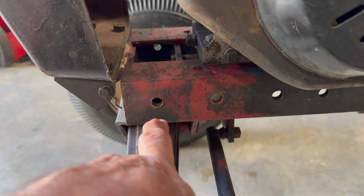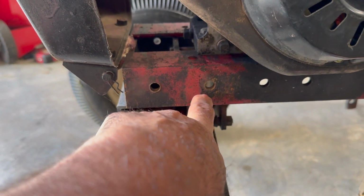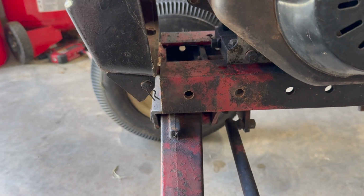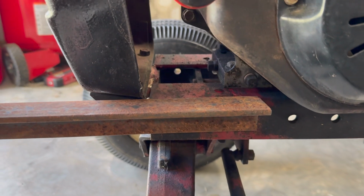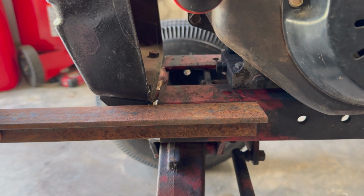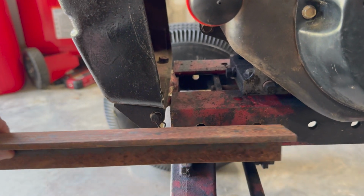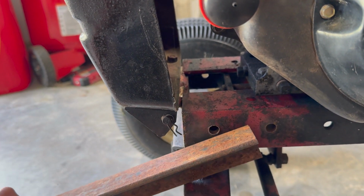Now I'm gonna hook one side up here with the vice grips and mark it from the end underneath side, and then drill them out, and they'll sit up on there like this. And if I have to take the hood off where I can get to that pin, all I have to do is take that front bolt right here out on each side, and it'll drop down like that.